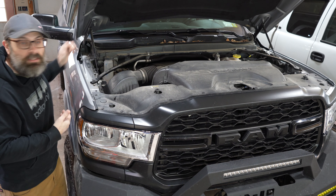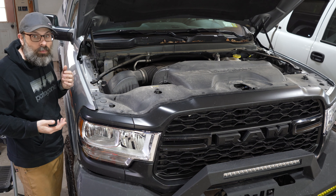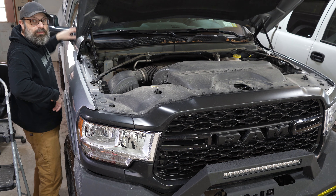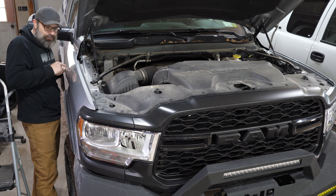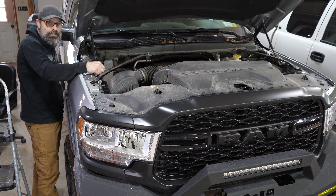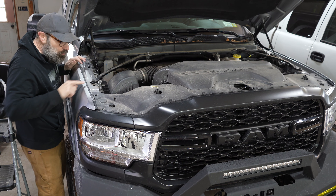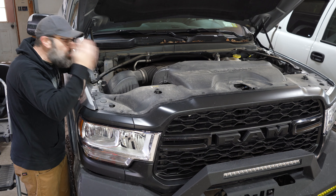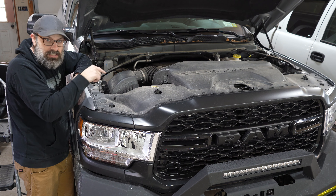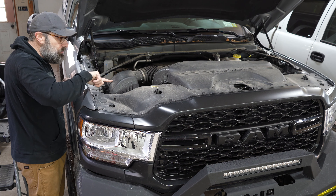You cut a hole right here in the fender and this panel needs to come off — it's body work, it's an in-depth installation. The snorkel comes through here. The intake part of it is right behind this panel, not inside the engine bay. This is important because of what I mentioned about the second battery — if it went through here we'd have a problem, but it doesn't. It goes through here and then enters the airbox right on this side. That's what the AEV snorkel does — it goes right behind this panel, through the framing, and right into the airbox.